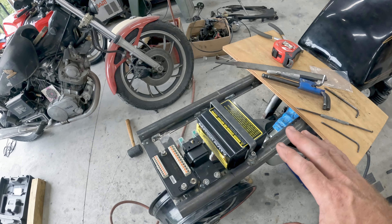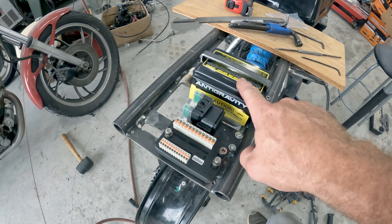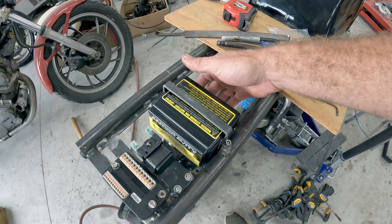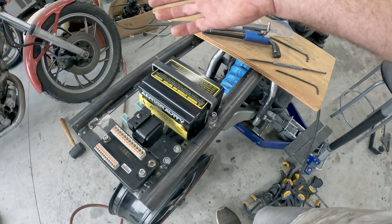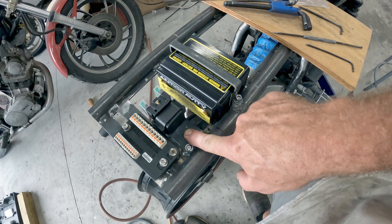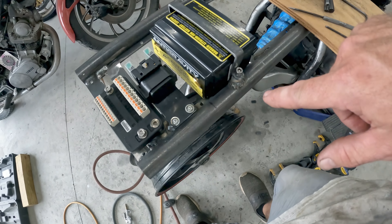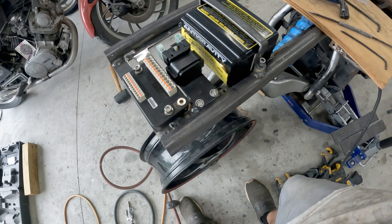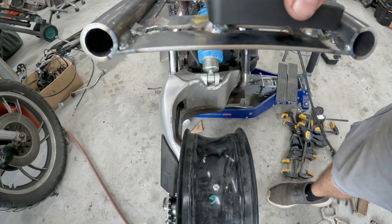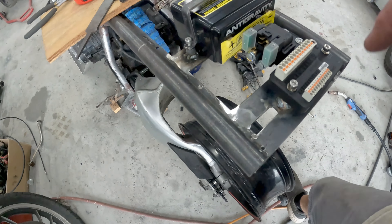I got all the mounts done. I even made the bracket that holds the battery down. You can see there's a decent gap underneath — that's because I put 3/16-inch rubber adhesive-back rubber on the bottom side, and I'll put it on the top section too so it compresses down on the battery. I already had the mount from my XV920R so all I had to do was make the standoffs. I machined them, tapped them for M5 thread, and welded them on. This is my start solenoid, and there's the Moto Gadget with the standoff underneath.